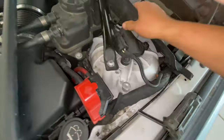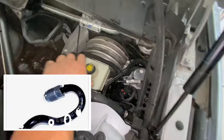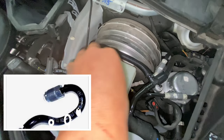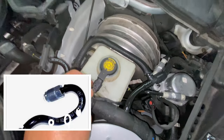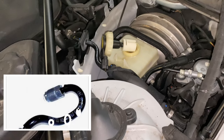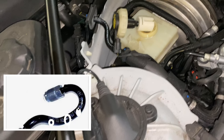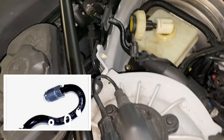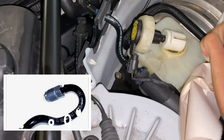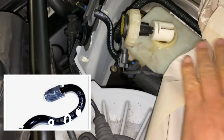Why doesn't a brake respond very well? The main reason is the brake fluid contains air. Under hydraulic pressure, air is much more flexible than liquid, just as you can press more air into a wheel. Air has stronger resilience to pressure. If your brake fluid contains more air, your brakes will become less responsive. You need to get rid of the air contained in the brake fluid.